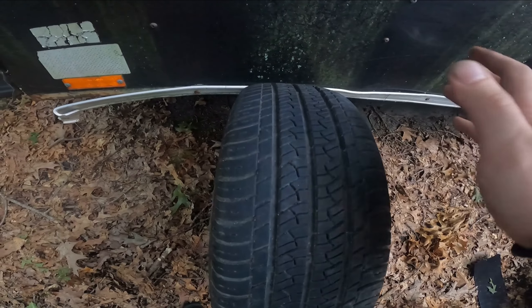The first thing I want to talk about when it comes to tires is looking on the sidewall — these three numbers right here. I get asked a lot about what these numbers mean. So going over it very simply: on my wheel and tire setup it says 185/60 R14. Starting with the 185, that is the overall width of the tire from sidewall to sidewall — 185 millimeters. Some tire brands do use inches instead of millimeters, so keep that in mind. Moving to the 60, that is what's called the aspect ratio, meaning the sidewall is 60% of the width of the tire — like where my fingers are.